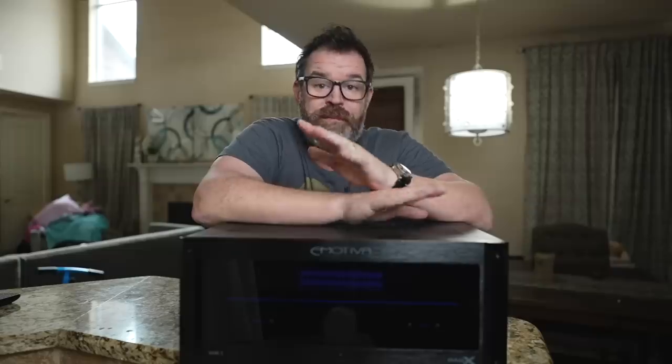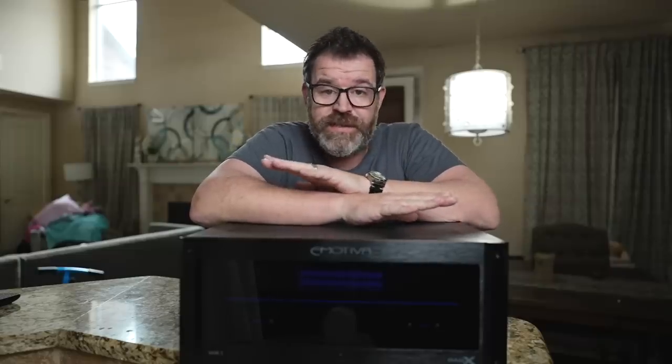And there's not many home theater companies that rate their AVRs at all channels driven. So you have a monumental amount of power just internally, but for whatever crazy reason you want to up the game, you need more power. With preamp outs on every channel, it doesn't make it a snap because you're going to have a big amplifier, but at least you have the option. I don't know. Some AVRs have preamp outs for maybe left and right, maybe the center channel. But what this really is, it's a receiver, but it's also an AVR processor.